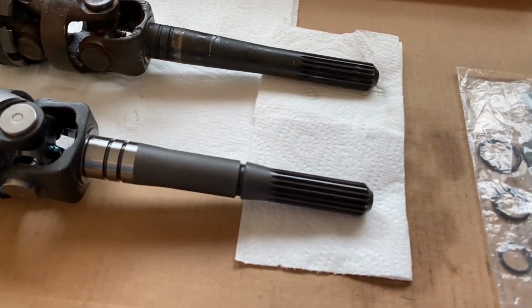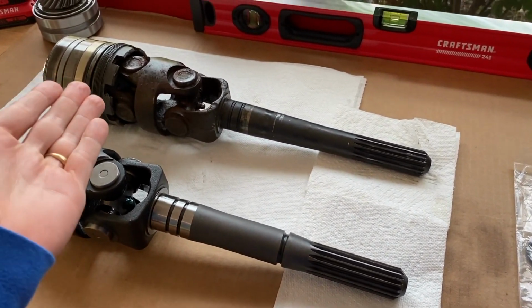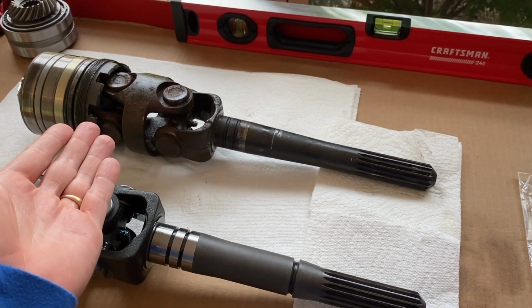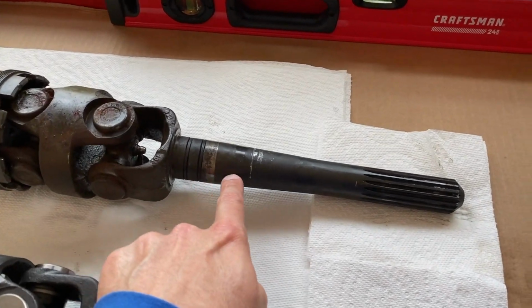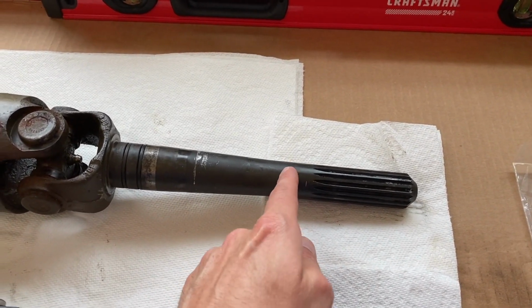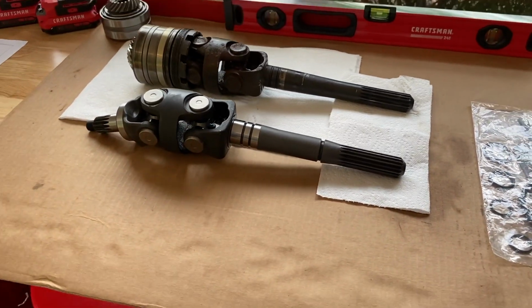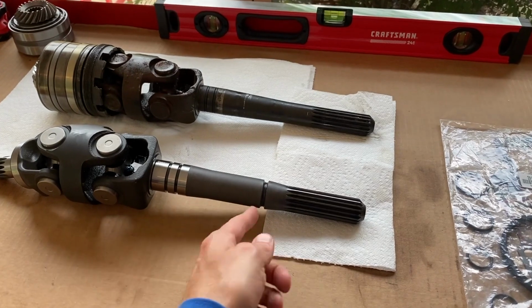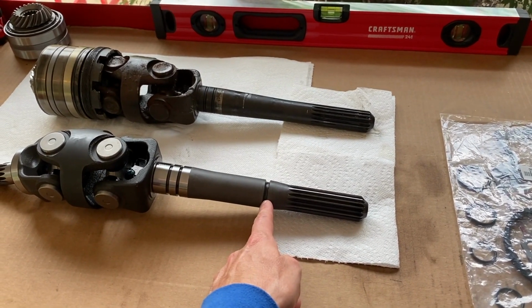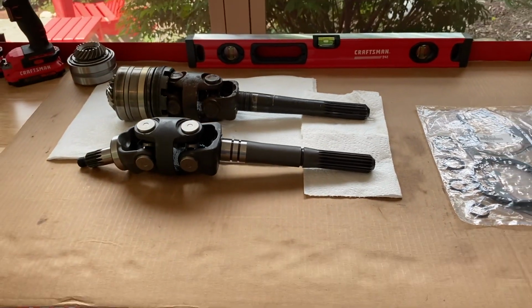So if you're thinking, I think I bought the wrong part, or you saw a picture online and matched it to your serial number, whether you've got an Alpha 1 Gen 1 or Gen 2 or Bravo, and the picture showed basically a straight shaft with no machine groove here, but when it came in the mail it looked like this, that is A-okay. Hopefully that helps answer the question. The new part looks different when it arrived, but if you don't have the brand new design engine coupler, hey, install the O-ring anyway, slide it in place, and it won't be an issue.